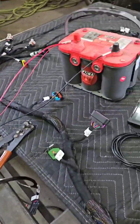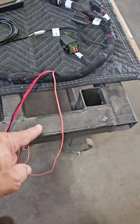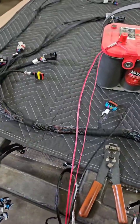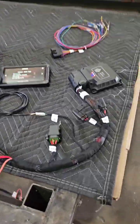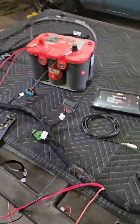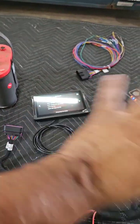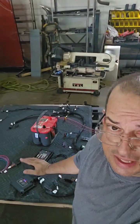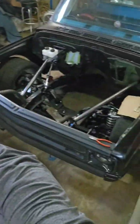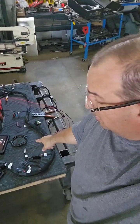Can't be afraid of fuel injection — it's three wires. One, two, three — makes everything run, and one for the fuel pump. That's it. Everything else is plug and play. So check it right out of the box, grab a battery, hook your three wires up, make sure it talks. Don't do all your programming yet, just make sure it talks — it's all working together. There's no need to go online and upgrade. It's Sunday, I've got bars to finish welding on Cochise, a lot of car to build, and then this all goes in on that motor. All right, bye guys.